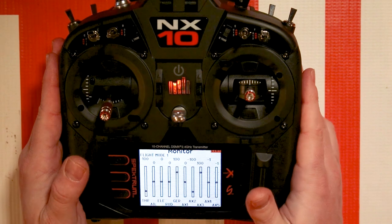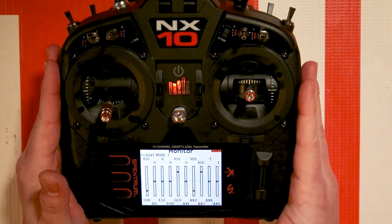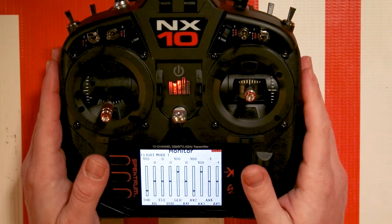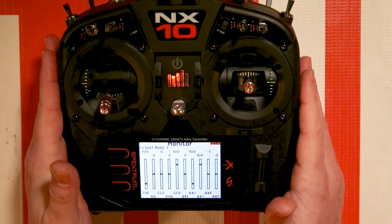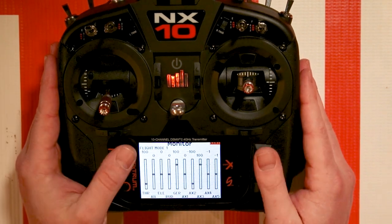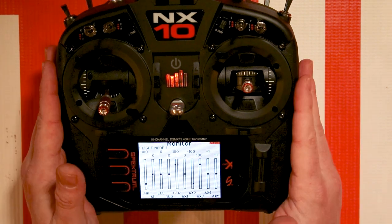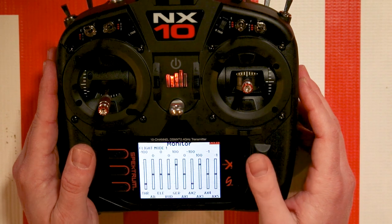So the first step, and one thing that I'll make a quick note of here is if you're having trouble with the thumbs twiddling Wi-Fi update, to turn it off, you will want to hold the power button for over 10 seconds or so. So just keep on holding it until it powers down if you get stuck on that screen. I'm not stuck on that screen. I'm just gonna go ahead and update it via USB.